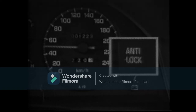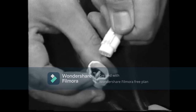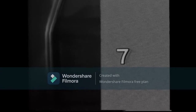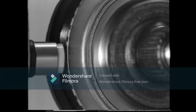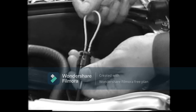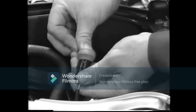If there is a malfunction, the warning light will come on and stay on. Stop the vehicle, disconnect the check connector, and check the blinking of the warning light. For example, code number 74 indicates that there is too much clearance between the rotor and speed sensor of the left rear wheel. When the diagnosis is finished, connect the check connector and remove the shorting pin from the TS connector and install the cap. With this, the malfunction code will be cleared from the memory.